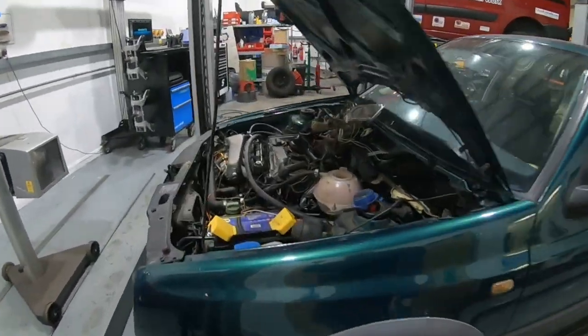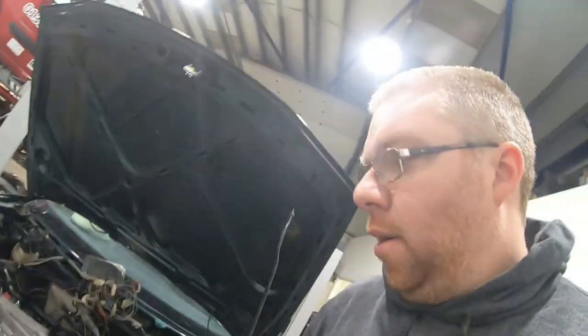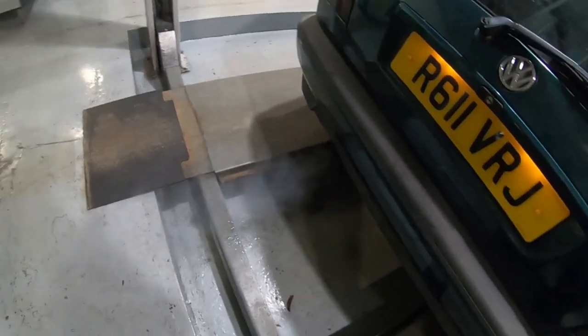So basically: drain, wrap cap, turn on heater, start engine, run vehicle up to temperature and idle for 30 minutes. I might have to move the car out. The level's still a bit low after doing all of that, but should be good enough. I've got some extra fuel for this, so start the engine up, heater on, let her run. About 15 minutes in — halfway through the Steel Seal treatment — and I think there is less smoke. We'll give her the full half hour, then let it cool down and do another sniff test.